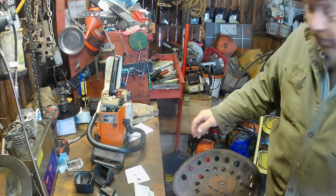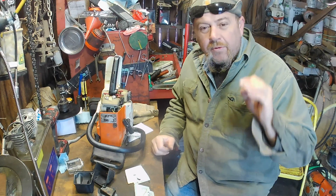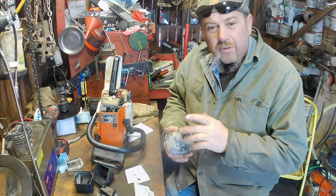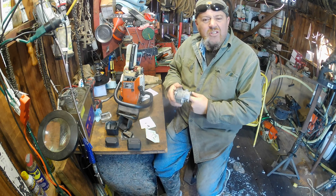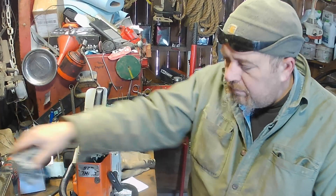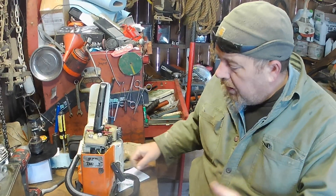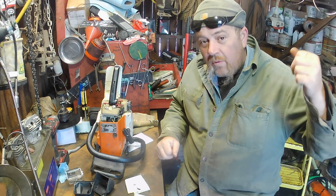Here's what we got going today. If you watched the last video all the way through, you know I trashed out the other cylinder. I did that with a boring bar — I got the exhaust too high, went back in with the boring bar, and scratched the cylinder about a quarter inch from the top. Junk. Oh, if it weren't for bad luck — or maybe it's just the fact that I'm a hack. Regardless, we got the new cylinder on there.